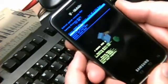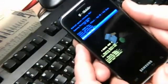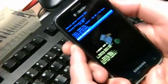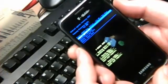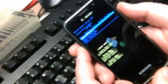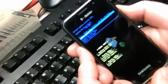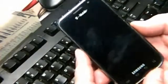Format cache data, wipe complete. Now we scroll down to cache data, select 'delete cache data', and confirm with the power button. It's all wiped — cache wiped complete. We choose 'reboot system now' and the system is rebooting.